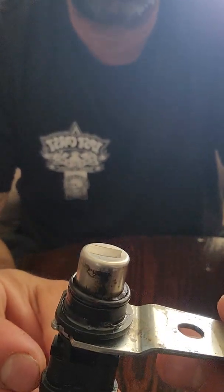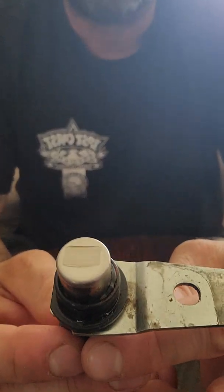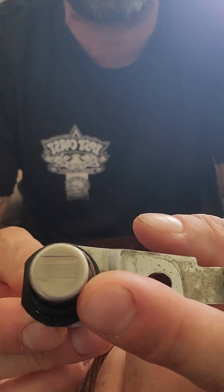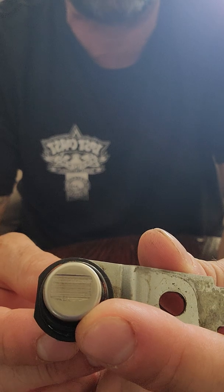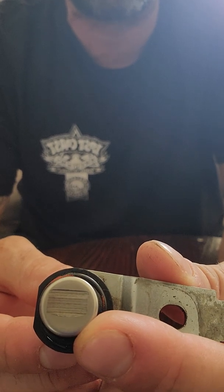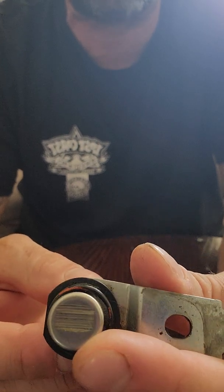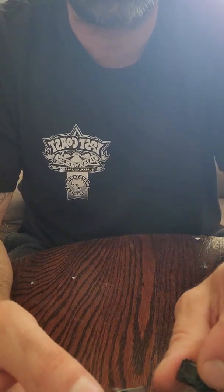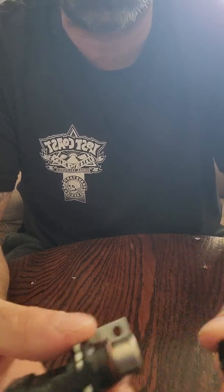This first video is basically to explain how one issue led us to further problems. I wanted to explain what this mark can mean for you: if you see this kind of damage on your crankshaft position sensor, it can mean your main bearings are either going out or have gone out, or something is causing that front gear to hit and damage the sensor. It's worth investigating further.